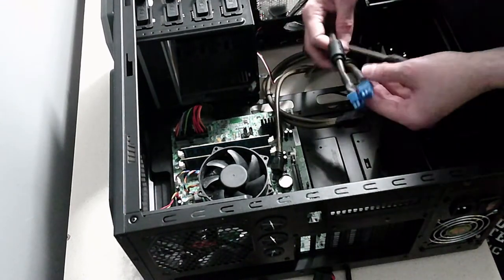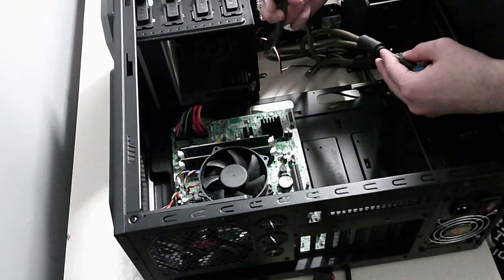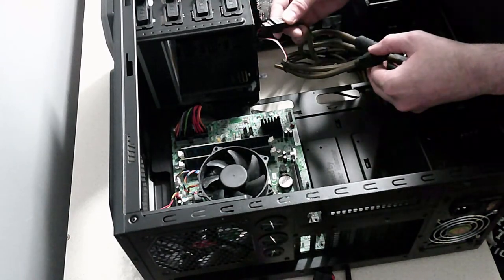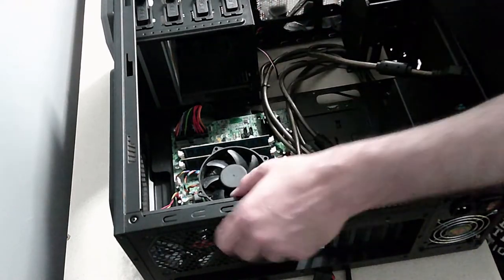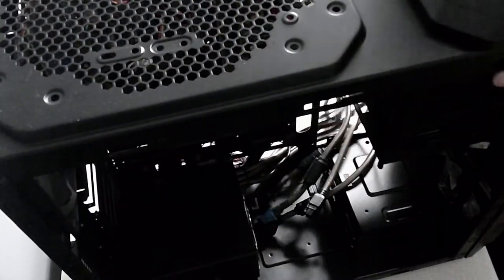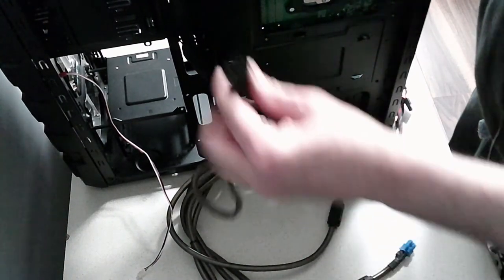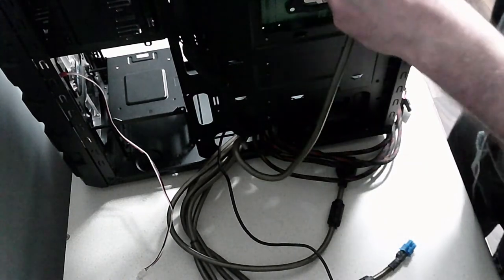Graphics cards, can't even get a graphics card. And then I have an 8-pin and a 4-pin here. It's a 4-pin because I've only got 4 pins there, so we'll be using that one. Again, just a little forethought in the beginning will help with cable management in the end. So let's bring these back out here. I'll just show you what I'm doing. I've pulled these cables back out the back. This is the cable we want, and we want it to go near the top through here.